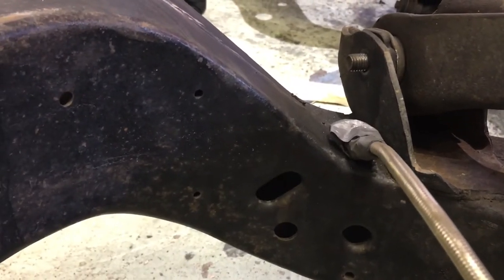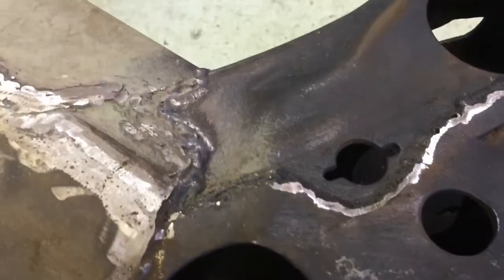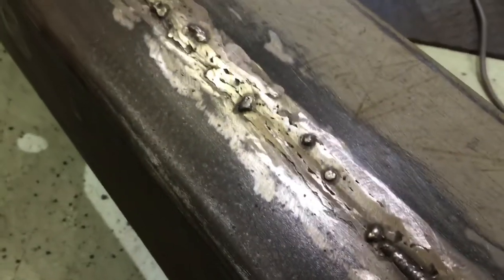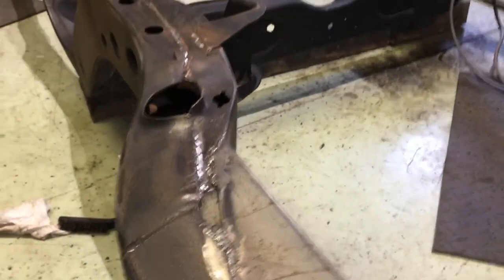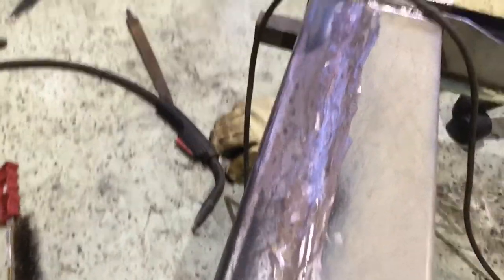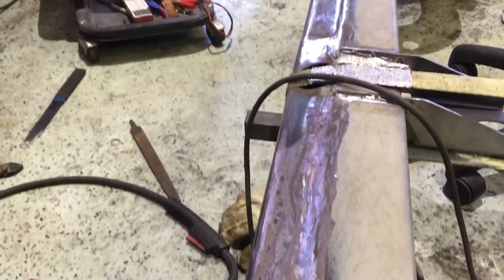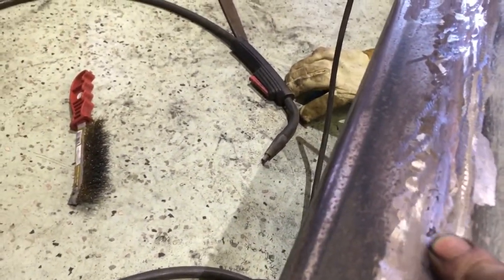Be careful not to fill any necessary bolt holes. That weird hole must have been some kind of hanger on the assembly line or something. This one here I've crowned it — basically I just weld it and keep welding until I get all the stuff filled in pretty good, grind it down, and keep hitting it. Got that, and re-welded some of these seams. I'm gonna try to get over all of them before it's all said and done. This one here is about ready for a little mud. I might put a straight edge up on there and run one more bead all the way down — kind of fancy I guess — trying to make it look like one piece.